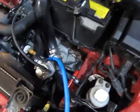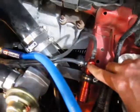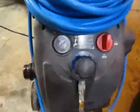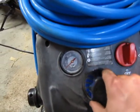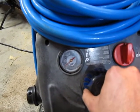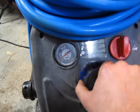I did it a few minutes ago and noticed from my manual boost controller that it's leaking air really significantly through the wastegate line, through this pinhole right here. I'm going to focus on that later. I'm pretty sure it didn't do that before, but we're gonna crank this up here to about 10 psi and see what it does. There we go, eight psi.